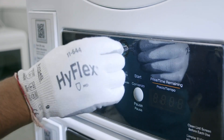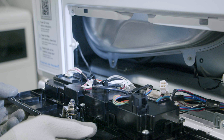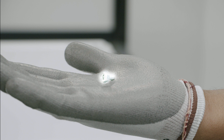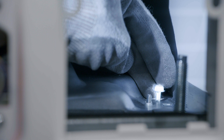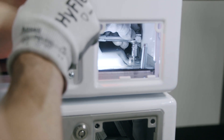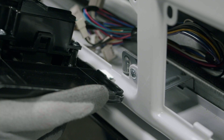Next, on the top dryer, use the access key to unlock and open the user interface control panel. You can tilt it sideways and tuck onto the dryer top shelf as done at the beginning — there is no need to disconnect any harnesses. This provides easier access for the next step. Use the one self-tapping screw removed earlier from the stacking bracket to connect the top dryer to the bottom dryer into the front right bracket. Tighten this screw using a very short Phillips screwdriver or 5/16 inch or 8 millimeter socket wrench, using one hand through the user interface control panel opening and the other through the coin drop opening. Reinstall the user interface control panel and lock it into place.